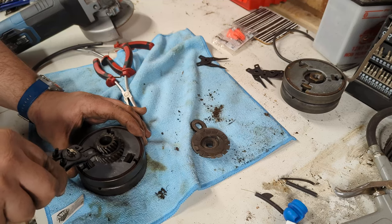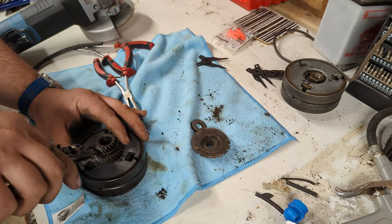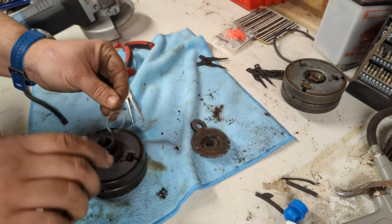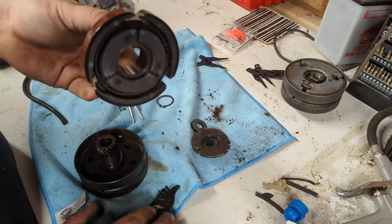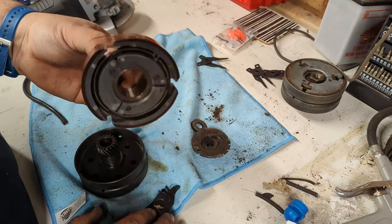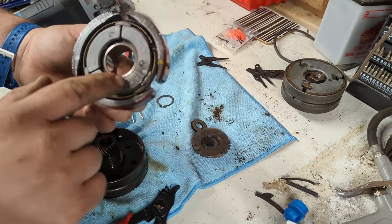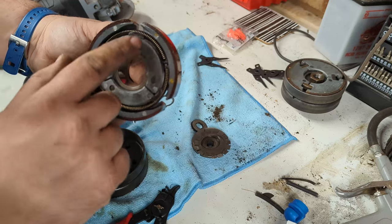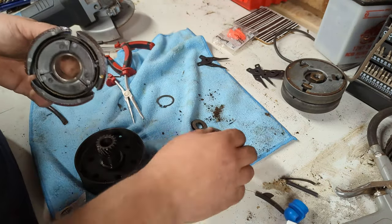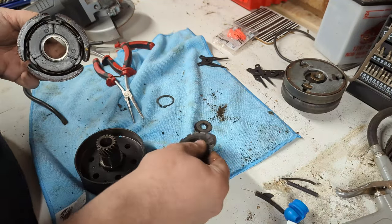It answers the question I posed earlier in this video about which gear exploded. It very much was first on the shift to second. So as the two tried to mesh, first gear juddered and exploded. Probably broke around this white, I don't know if it's white metal or soft metal, I don't know what it is, but it feels soft. These weaker metal bits here, and so everything that you can see here are all parts that are actually inside the first gear on this good one over here.